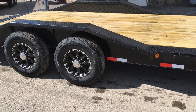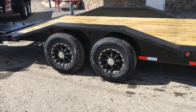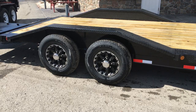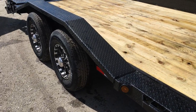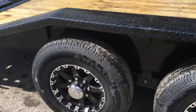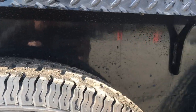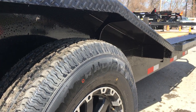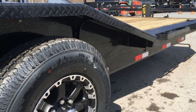Another feature we like on these: the drive-over fenders, instead of being a 6.5-foot fender like some, measure out at about 9, 9.5, or 10 feet depending on the trailer. So you get a much lower-profile drive-over fender — much more user-friendly. They put gussets inside front, middle, and back, so you've got plenty of extra support. They're also using a heavy-gauge drive-over fender — I believe those are 7-gauge or 3/16.